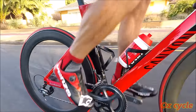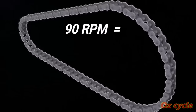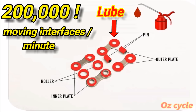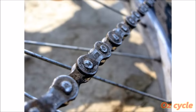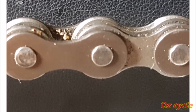Your bicycle chain is a moving mechanical part, like the bearings. However, unlike bearings, a chain has many more moving parts. At a nominal 90 revs per minute, there will be 30,000 link movements. Taking a closer look, you see each link is made up of many parts. These parts articulate against each other and so require lubrication. All up, there are 200,000 individual moving surfaces per minute that need to be lubricated. Even though a chain is not covered, the lubricated parts are not visible, because they are enclosed inside the chain links. The only lubrication you may see is on the edges of the link plates, as shown here in red. Any excess lubricant on the outside of a chain will only attract foreign matter, like dirt. Even a freshly cleaned and lubricated chain will attract foreign matter if just a thin film of lubricant is left on the outside of a chain.